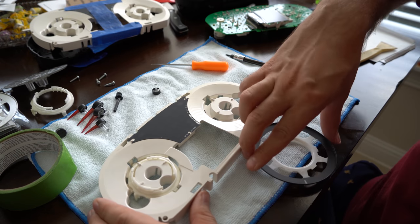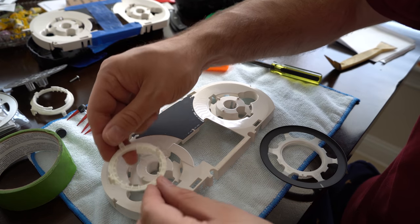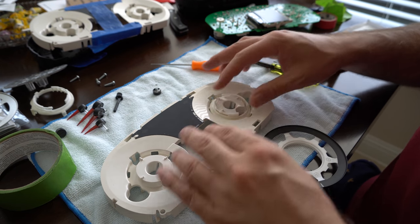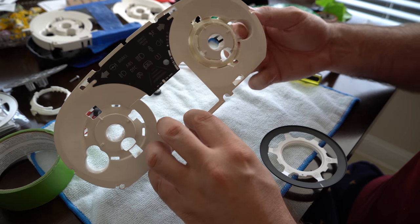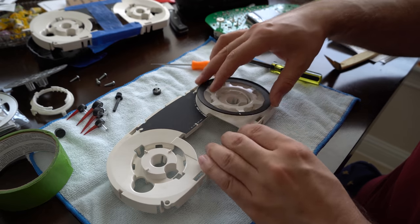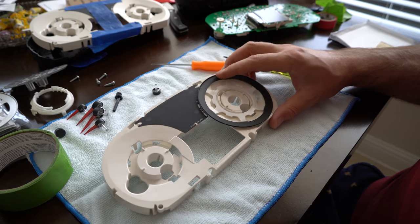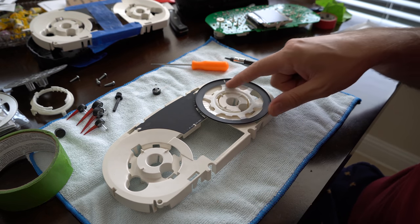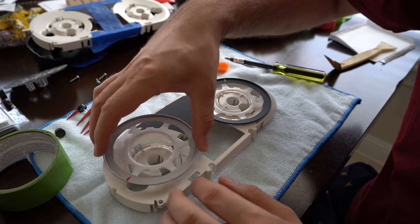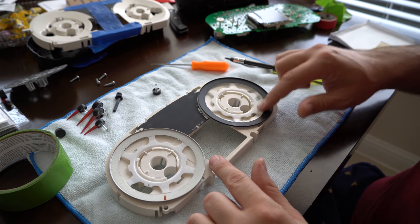So what I can do is take this out of here, take it, flip it, bring it right over here - snaps in. It's got the exact same relief and motor pass-through as if it was ready to be an M3 cluster - kind of crazy. Put this over here and here's my variable RPM for my stock cluster. So you have to have a spare cluster, you gotta buy a used cluster to do this. But there you go - variable cruise control, variable RPM.